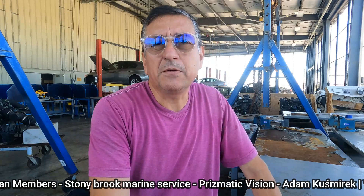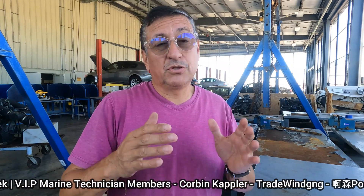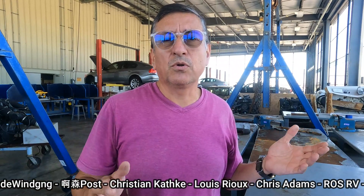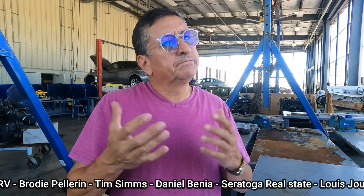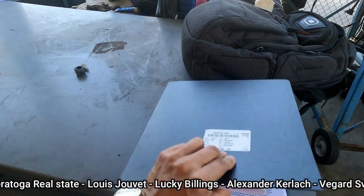Today it's easy to take pictures about the actual situation. Try to make a drawing about the connections, because two weeks later, a month later, when you receive the new parts, you don't remember where those cables are or the position of the components. Mark with a sharpie in different colors the position of the bulb with respect to the case. And always, always check the service manual.